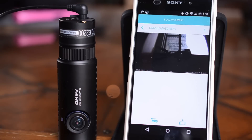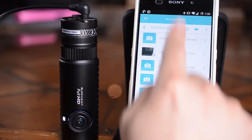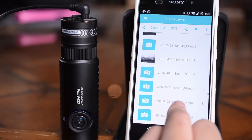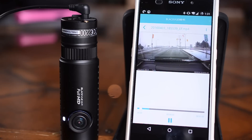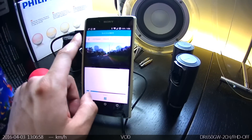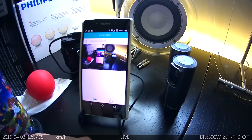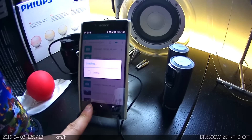The smartphone app is more complicated, but most people shouldn't have a problem. The Wi-Fi mode allows you to change settings, view, and download videos once you connect to your camera's network. Once inside, the starting screen shows your saved videos. Locked files display a thumbnail so you can easily find important videos that were manually saved or triggered by the G-Sensor. You can watch videos using the built-in player, and you can download videos to your smartphone, but it was rather slow, taking around 25 seconds to transfer. What's great is that while viewing videos or downloading files, your camera will continue to record — this is quite a technical achievement as many Wi-Fi cameras require recording to be disabled first. This could come in handy after an accident as you can keep your camera rolling while quietly reviewing what happened.